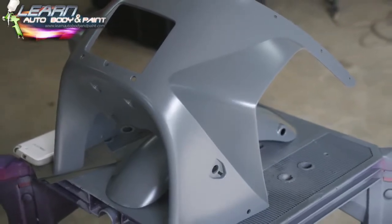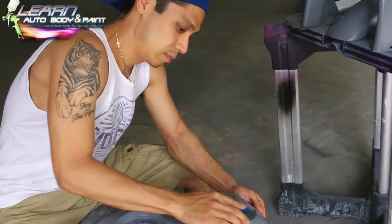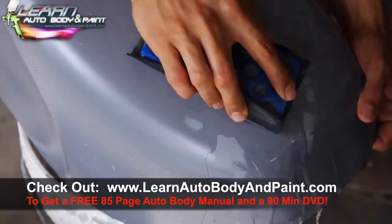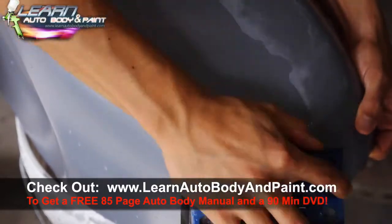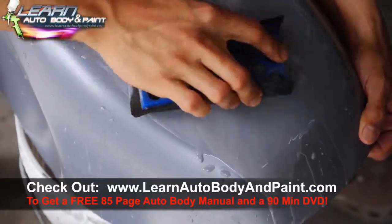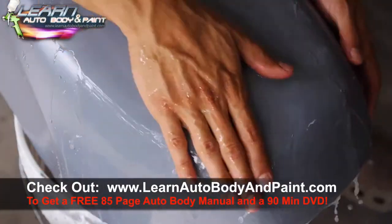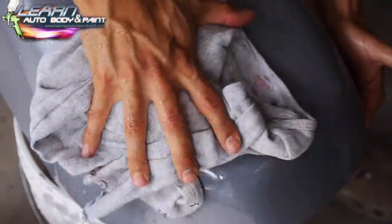We did this to all the parts. Now, water sanding — I'm going to sand that out right here on video. Once this is flat with no imperfections, that's how it's going to look when our paint is on it. This needs to be totally beautiful looking with no imperfections, no orange peel, before we get our paint on.